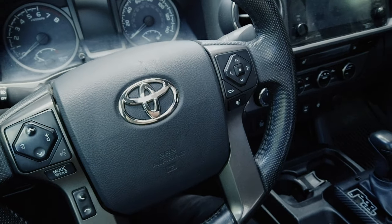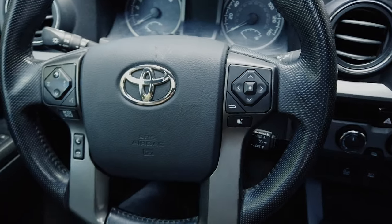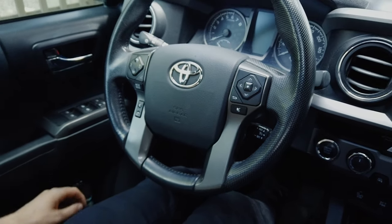I got the airbag module and seatbelt back after about a week. I went ahead and plugged in all the airbags — the side curtains, both seat bags, the steering wheel, and the knee airbag — making sure the battery was disconnected and there was no power in the system. Once I confirmed everything was plugged in and the connectors were secure, I connected the battery and sure enough, the airbag light was off. Good to go.